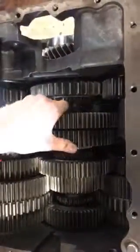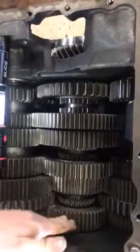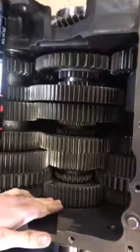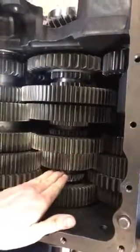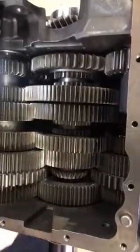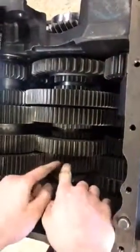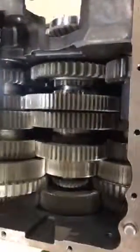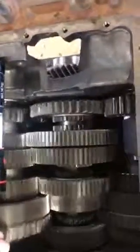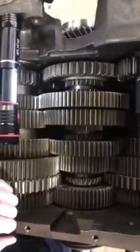It will work the exact same way for seventh and eighth. Then ninth will again be on the drive gear — direct power all the way through the main shaft. And tenth will once again run from input to drive gear to the counter shafts. So I'm Calvin Kaiser here at JTEC, and that's how an Eaton Fuller manual transmission works.